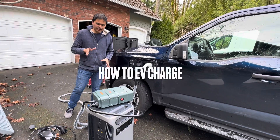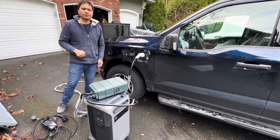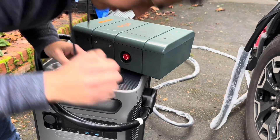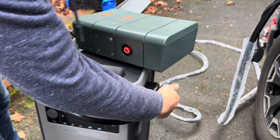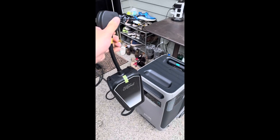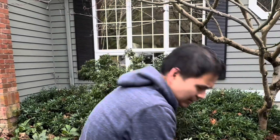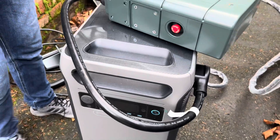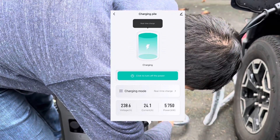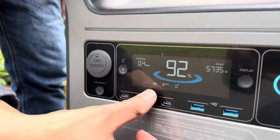For EV enthusiasts who want portable charging, it's actually not as straightforward as it seems. It really depends on the charger you use with the Anker Solix. This is a V-Vor charger with a NEMA 14-50 charging port. Pay close attention — in the manual, this is a 240 volt outlet at 25 amp max. If you were to use the charger that comes with the Lightning, that's 40 amps, and you can't really change that without a smart app — but the V-Vor does have one. You can control it with your phone via the app. To EV charge, make sure you double-tap to turn on the AC power section so it's in continuous discharge mode for EVs.